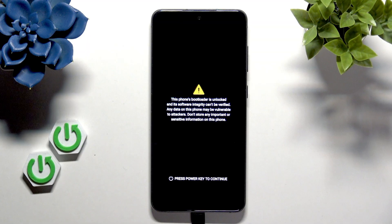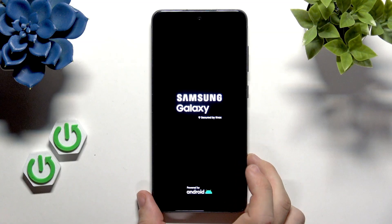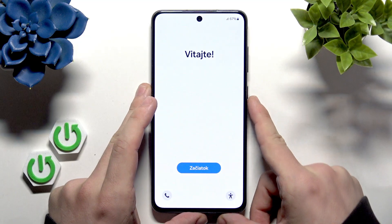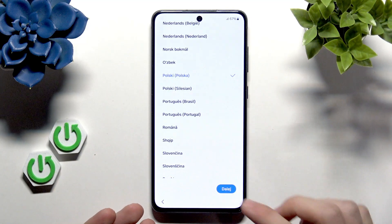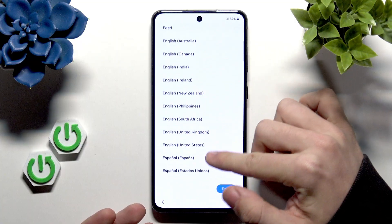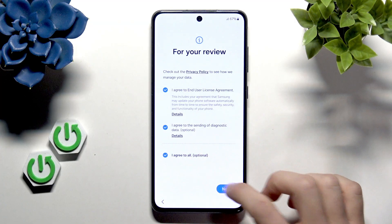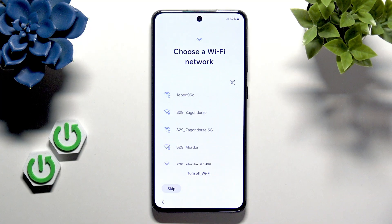It does take some time, for sure. By the way, you can unplug the cable already if you want. I'm going to get back to you because it may take a few minutes. And I think it's already reset — yes, it's already done. The bootloader is unlocked, but it's worth setting your phone up real quick just to see whether it's for sure unlocked, because sometimes there may be a little bit of a problem and you may need to do it again. Just connect to Wi-Fi and skip everything else as much as you can.